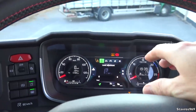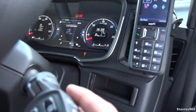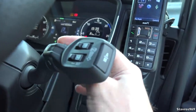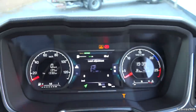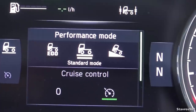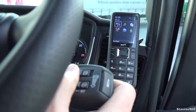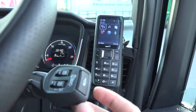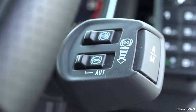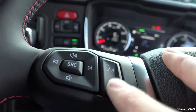Of course there are more modern layouts now, but this is still nicely done. Going down through our driver modes — it's no longer adjusted here like you would have before, where you would slide that forward to go down through power, standard, and eco mode. It's here now — if we press that, we are in power mode. Press it again, we're in eco. And then standard mode — I'll be testing all of them on the drive. And we have the auto function there for your retarder, an auto function for our exhaust brake, and a manual function there. I really like the OptiCruise gearbox just up and down through your gearbox manually, and of course a five-stage retarder. And your cruise control here as well, and our hill descent control. And yeah, voice activation — we have that.